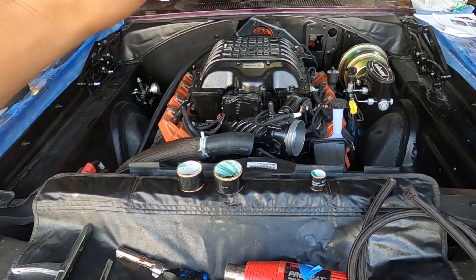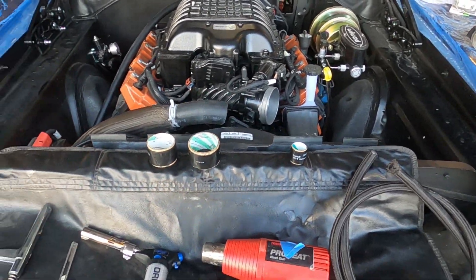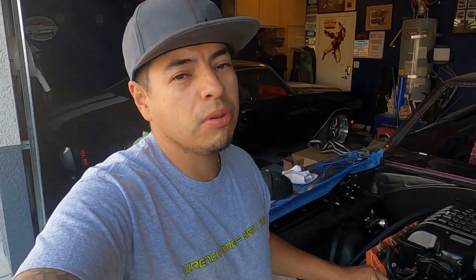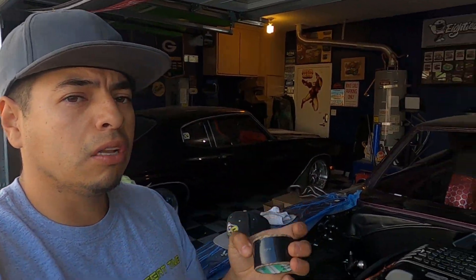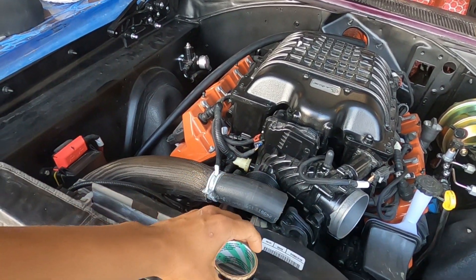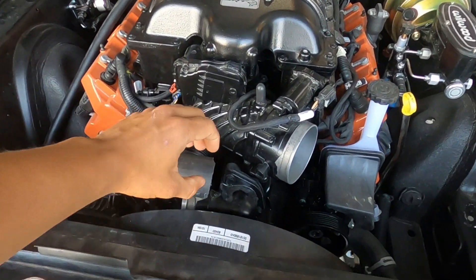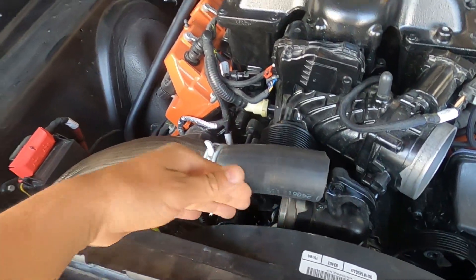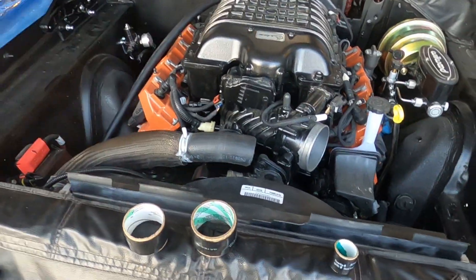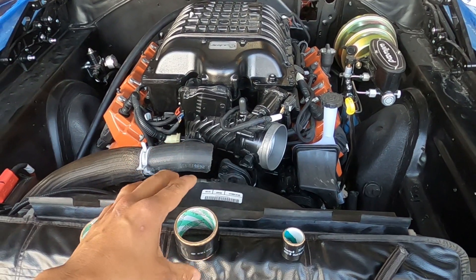What semis saw was a lot of temperature drops and rises just driving freight. What makes these things special is that they're made out of a thermal plastic, which means they're also heat-shrink. You apply heat in order to install them — just like heat shrink, they shrivel up and take the shape of the hose and whatever they're plugged into, whether it's a radiator, heater core, or anything like that.